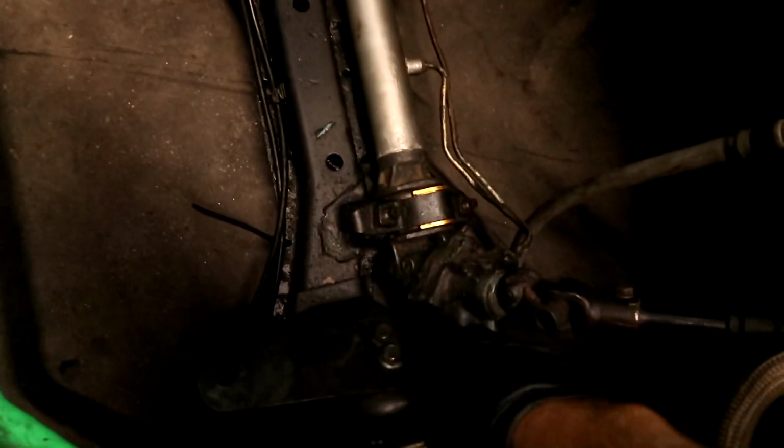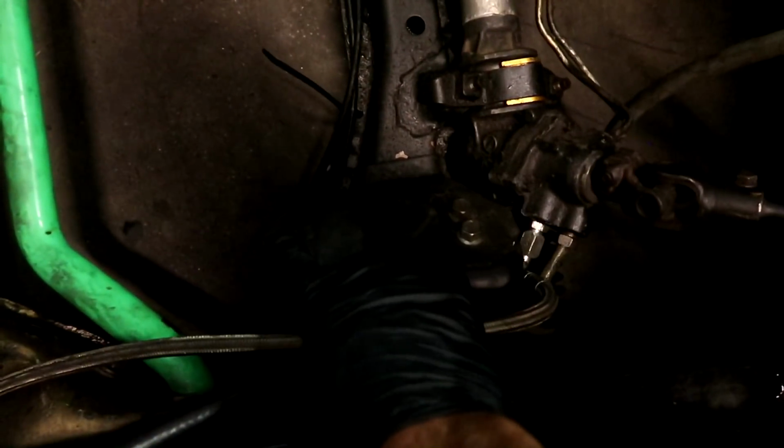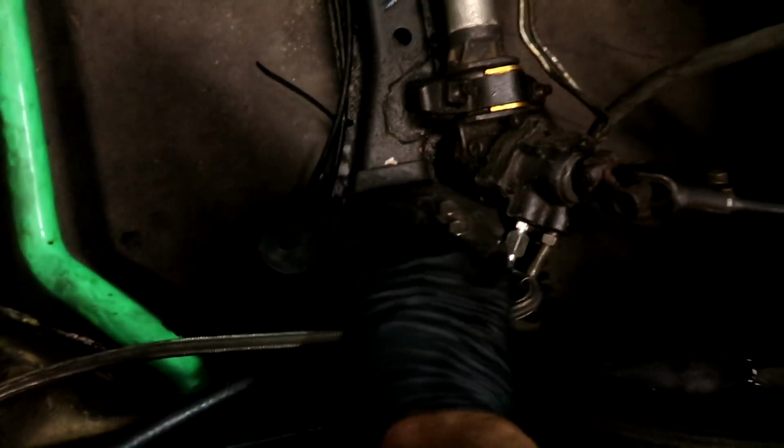And the main reason was because when I looked at Adrian's car, I'll show you guys real quick. Adrian's car right here, S13 front subframe crossmember. See how far up it needs to go in order to fit an RB? That right there is about a good 5 inches, 5-6 inches. So in theory, what we're doing is taking the R34 one out, gonna put the S13 one in,